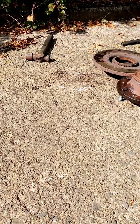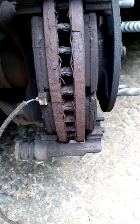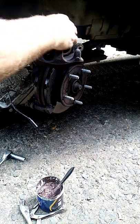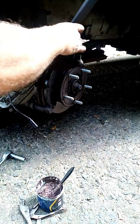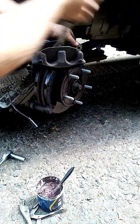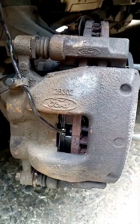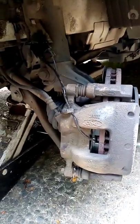Good job. So that's the passenger side done — disc, pads, new sensor, clipped in, all neat where it should be, job done. There's the front ones, very nearly worn down to the centre there, so we'll get a new set of pads put in the front. Get those front pistons wound back. Front pads in — so that's rear discs and pads and front pads. Job done.